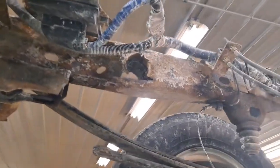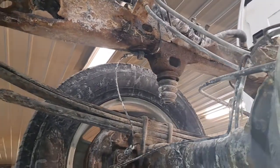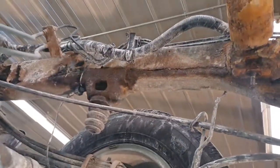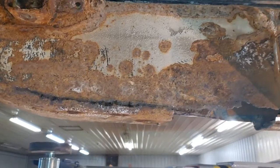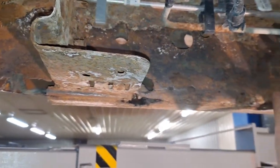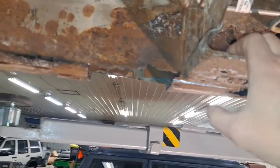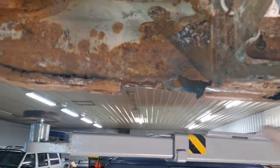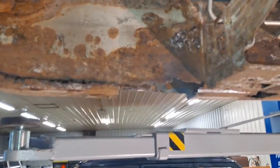As promised, here's a look at the frame with the gas tank out. As you can see directly above the rear, there's a rust crack about a half inch from the bottom of the frame going forward. Where the gas tank was, it gets larger and continues on — it actually goes all the way up. We took a needle scaler and started cleaning up the frame. We're going to plate on this side from this cross member back so we can weld that in. We've already started cutting off what I think is the evap canister mount — we'll plate everything, plate the bottom, plate the outside as well, and then weld this back on.